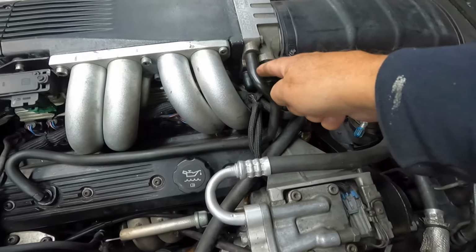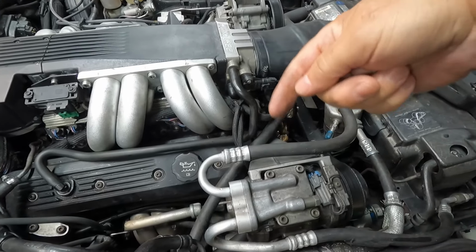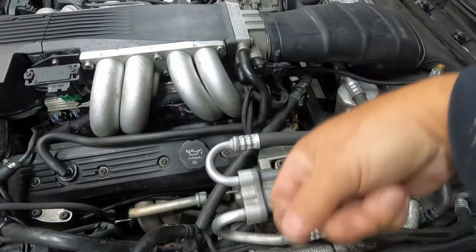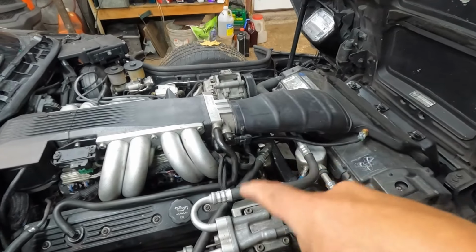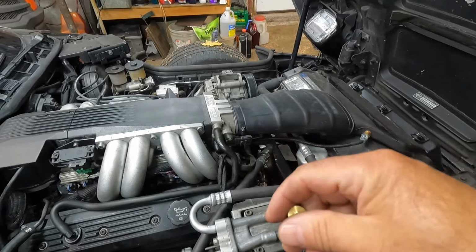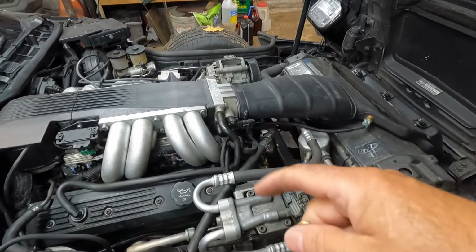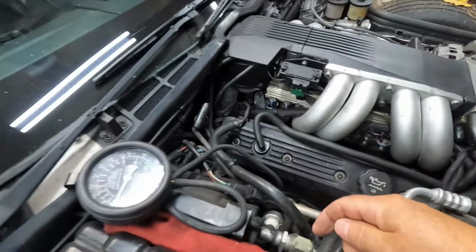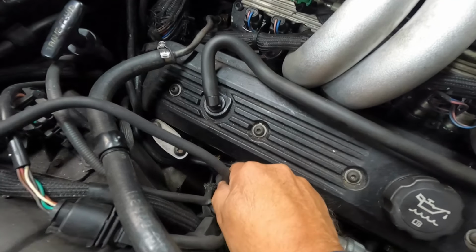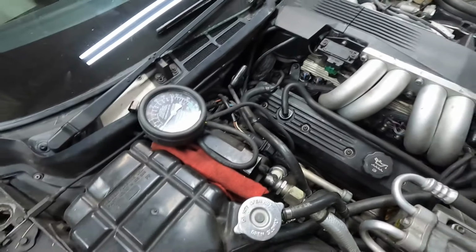Now, the thing is, if you have to get that out, you just put like a little coat hanger or something in there and hook it on there and pull it out. So if you decide to take it out, start with an 1/8 inch. If that ain't enough, go a little bit smaller. I wouldn't go too much smaller than an 1/8 inch. If you got that much blow by, well, better just consider getting a motor. But here you can see I have the vacuum gauge hooked to the dipstick tube.